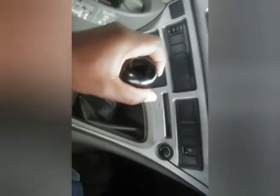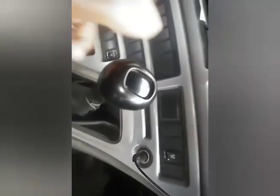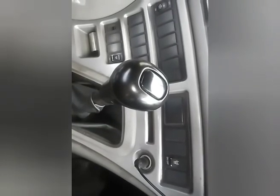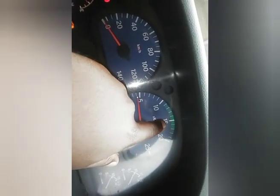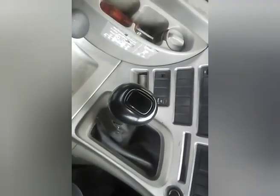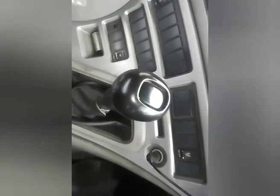Press down the clutch like this, then look for gear number one. Make sure your revs go to around 15, then press here. Now it's high. Then press clutch and release — one high will be in. Press here, come back for gear number two, but now it's two low. When your revs get to 15, come back to two high.